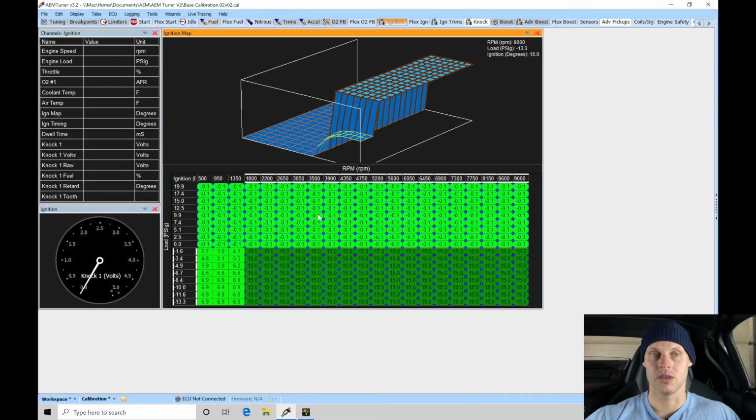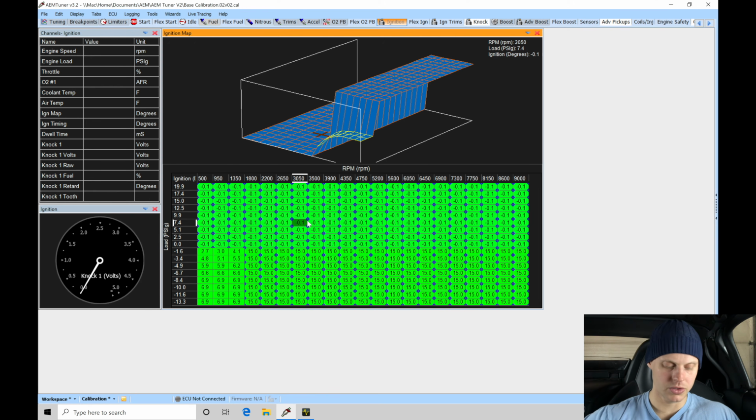And then if you're, in this case, turbocharged, we can start to bump the boost up and look through that process. And we'll be exploring all that. But this table right here will get me going in the next video, so I don't have to worry about damaging the engine to get my fuel dialed in. The fuel always is going to be the first step, and it's probably not the most important, but the most relevant. If you're too rich or too lean, the engine will run terrible. You can have spark timing in the range of where it should be, and the engine will still run and drive. So let's do Control S here.